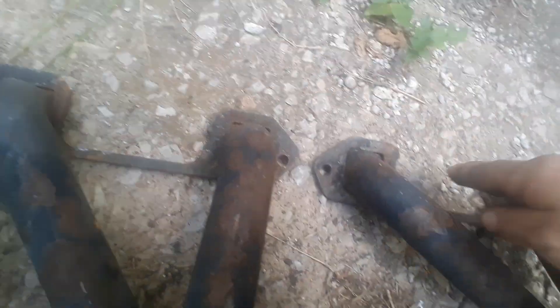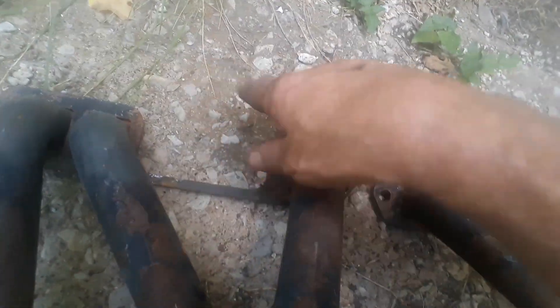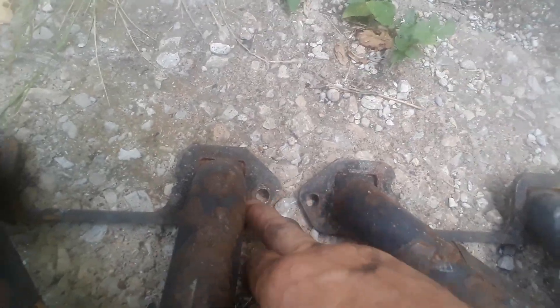The intake manifold goes here between these two areas and it shares bolts, so you can bolt your intake manifold up there along with it. I've had it on there and it fit and it worked, but they leak. I had to get under there and tighten them up, and after you tighten them down they start leaking, it burns the gasket out, and then you can tighten it all the way and it's still gonna leak. So do I just go buy another exhaust manifold, or do I use these headers?